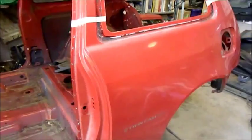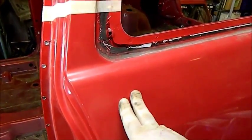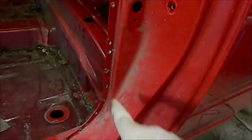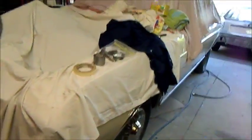We can use that. And the other thing that's very good is I need to brush up on my welding skills, and this is very thin. It's probably only about 0.6 or 0.8 sheet, and we have to butt weld it across here and also plug weld it all down here and underneath and all the rest of it. So this is a great car to cut our teeth with welding when we take on more expensive stuff like this one. I've been relying on friends to help me with welding for a long time now.